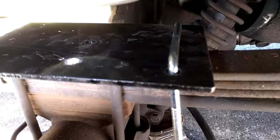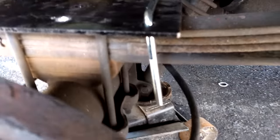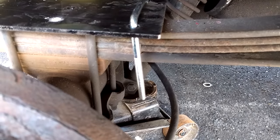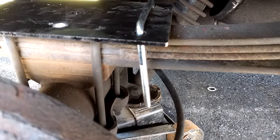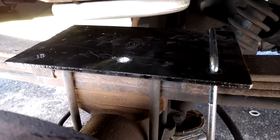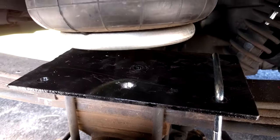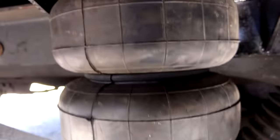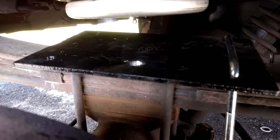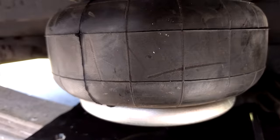Tighten them in place - the bottom is pushing down on the spring in numerous spots and the weight's spread out across where the axle's at. I don't think there needs to be much in the way of support, it just needs to hold it in place. Quarter-inch steel pushing down across the spring is going to be plenty strong enough.